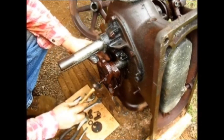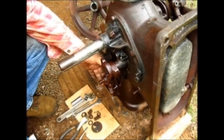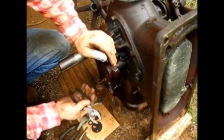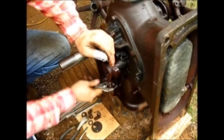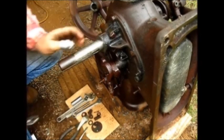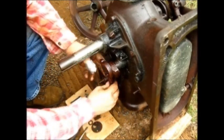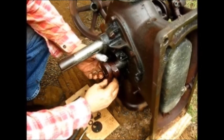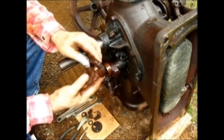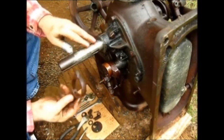It's that arm part right there. Actually, it's not too bad — maybe we can get that off of there. Loosen this up to where it comes out of that fitting right there. Once it comes out of that, you can slide it sideways, meaning that way. Like so. Once it gets around there, you get this off. The other type for the fuel pump roller is on the bottom right here — we'll talk about that later. This one is a nice shape around through there. Let's get that in the electrolysis tank.